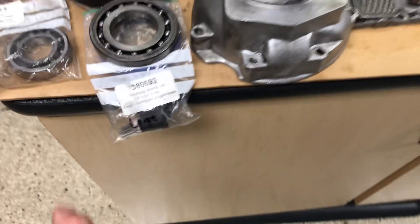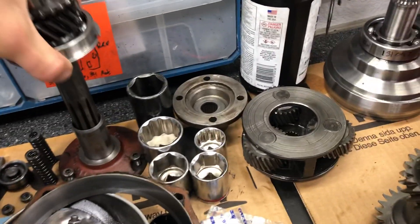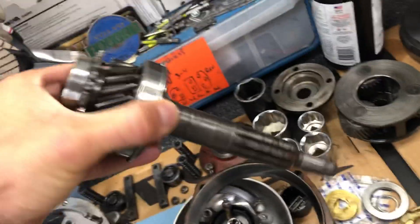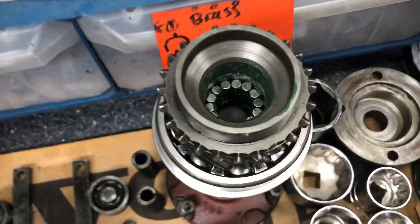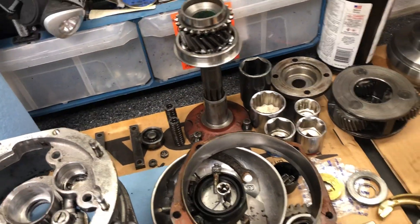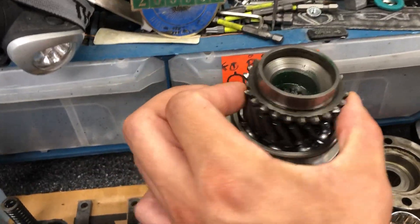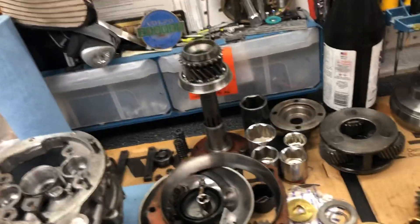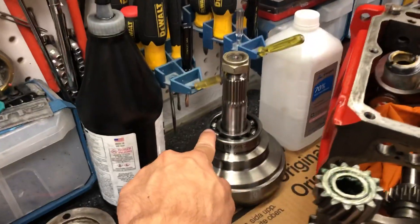You can see one of them is broken and we'll get to that when the video is put out later. 11145 — that is on the input shaft of the transmission. So this is the part that goes into your clutch. Inside of there are some roller bearings; I think it's 14, maybe. This is not a broken tooth — that's actually how it was designed to have either side missing there. That's a really nice bearing to have, and that one does get pulled out and pressed in as well. It was a little difficult.